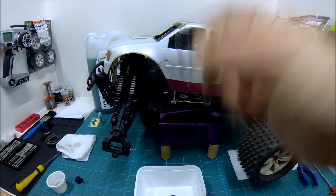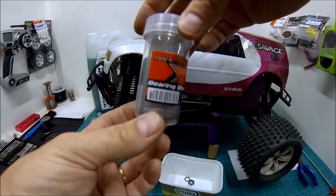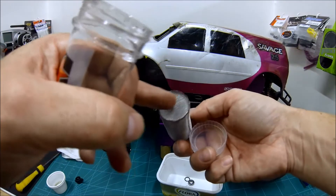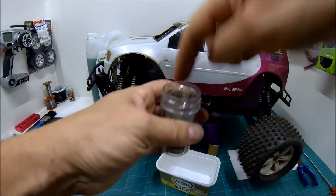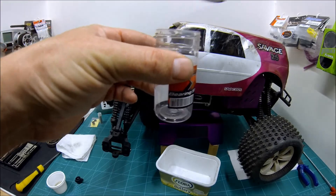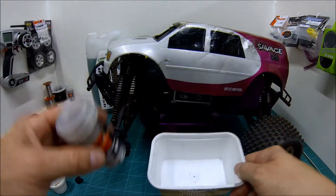There's a little product I've seen recently. I found it on Hobby King — it's called a bearing shaker. Basically it's a plastic pot with a little metal cage inside that has a base slightly raised off the ground. You can put your bearing parts in the middle, fill it up with your favourite cleaner, and any bits of grit are collected on the outside below where the bearings are sitting. Then you just pull the cage out and dry it off. It also helps save on cleaning fluid, since filling a whole tub uses quite a lot.